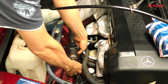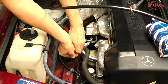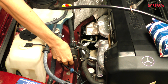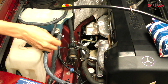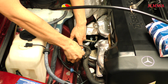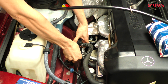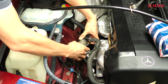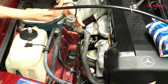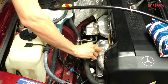So removal of the pump is pretty straightforward. The original pump's connector is clipped on the side. We're not going to need that clip anymore, so that will get removed from the bracket later. And the original harness fits perfectly to where it needs to go, so it's like they were thinking of this already back in the day. The pump should slide out of its rubber mounting. Sometimes they can get a bit stuck in there and require slipping something between the rubber and the motor to break it free, but that was not the case here. This has obviously been out before for someone to play with, and I know I was one of those someones when I had to free it up and unseize it.